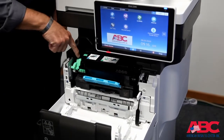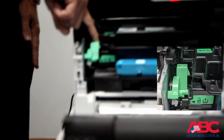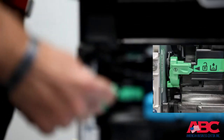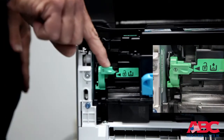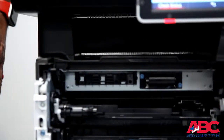The next step is there's a lever on the top left as you're looking at the actual toner cartridge. From there, we want to push this all the way down. After we've pushed it down, we want to push it a little bit further such that this arrow lines up with this arrow. At that time, hold on to the blue. You have successfully removed the toner cartridge.